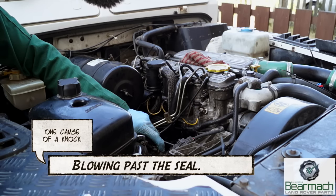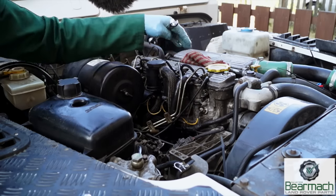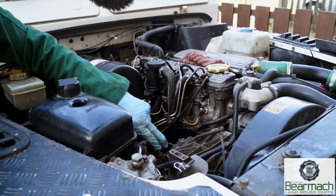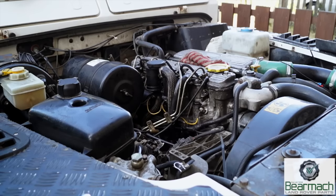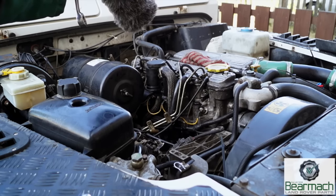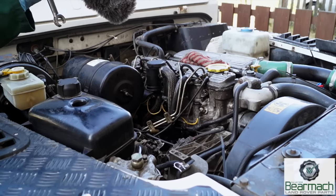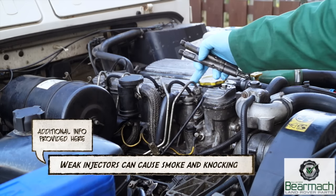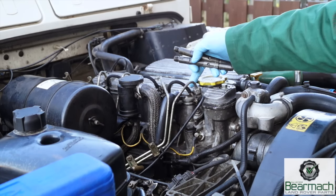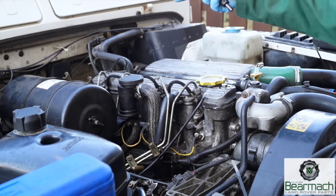When a knock isn't a knock but rather a blowing sound which appears as a knock, it's a loose injector. A loose injector will actually cause bad idling and a knocking. This is basically because the compression is going past the injector. The cause of this is the sealing washer at the bottom of the injector not sealing, or the injector has not been fitted or clamped down tight enough. One of the reasons for excessive smoke and a combustion knock is failing injectors. I have two decent injectors and I can hear a knock on either cylinder one or cylinder two, so we're going to replace these and change the pitch of the engine. The injectors need to come out and I'll show you how to do that.